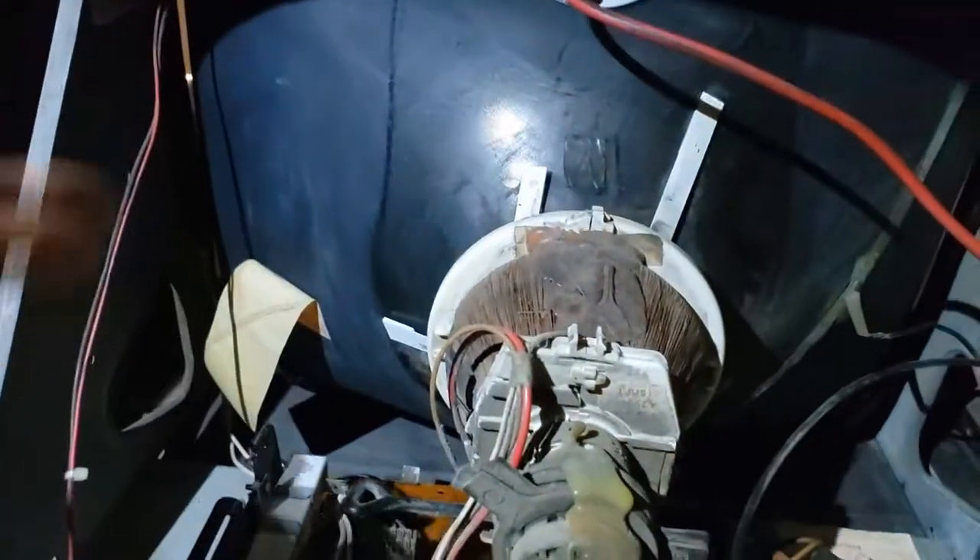I use them to converge the monitor. Careful, there's really high voltage coming out of that right now. So these tabs — do they come with it? Yeah, in the factory they will, but that one I just put in.